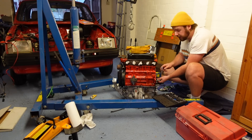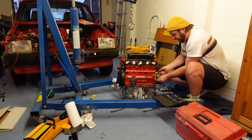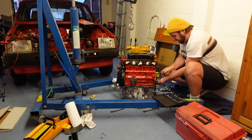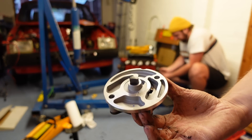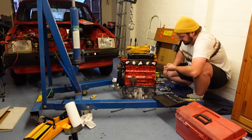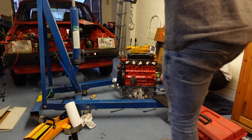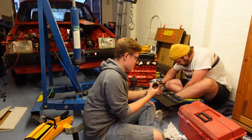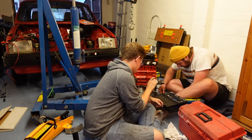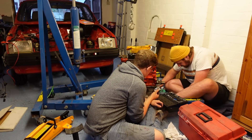We're going to install a new oil pump, which hides behind the clutch casing, so this is the best time to do it. The oil pressure light did always take a second to go out, so this is cheap insurance. This is primed with a little fresh oil and secured to the end of the camshaft with its gasket and two bolts.